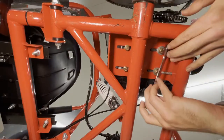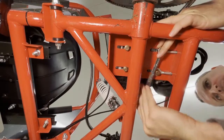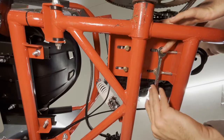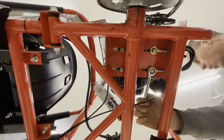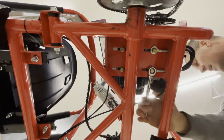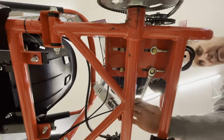As you're loosening these bolts up, when you put the wrench there — if you're behind the cart — you want to pull the wrench towards you to loosen it. I've got that ring end on there. You can see I'm pulling this open end towards the back of the cart to loosen these up. I'm going to start on number one of these four 13mm bolts. If you have a ratcheting wrench, you'll see how this works — start to loosen the bolt, then just ratchet back nicely. I'm going to go through and do all four.